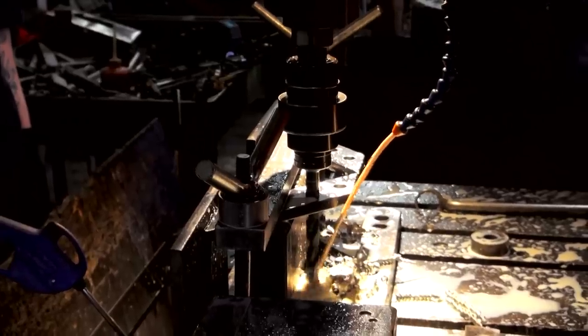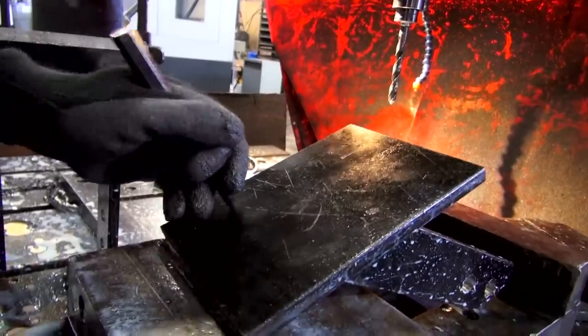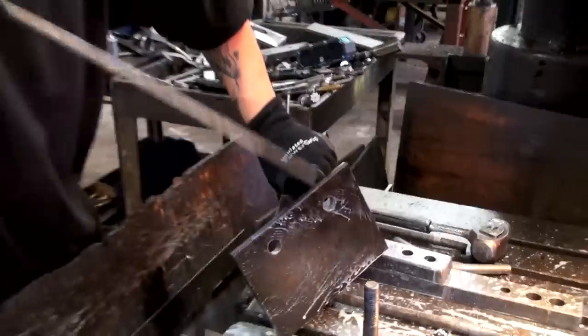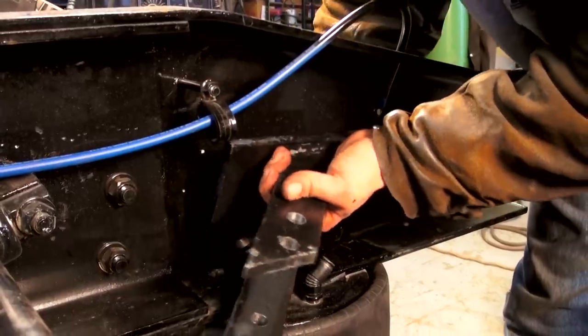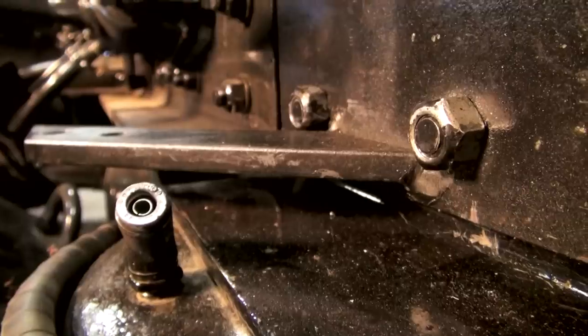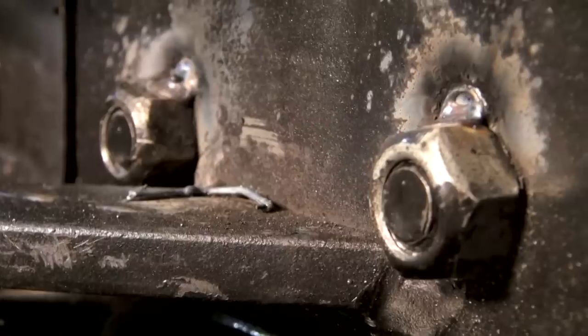The top of the bracket which holds the rear crossmember — you'll want to drill all the way through. There will be two holes top and bottom, and then you'll also have two holes that go through the frame. Install your brackets and snug down the bolts. It's best to leave one side just hand tight. On this particular truck we've tacked the nuts to the rear crossmember itself to make it easier to torque the bolts on the outside of the frame.